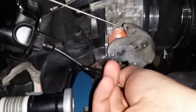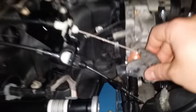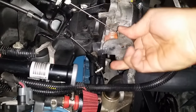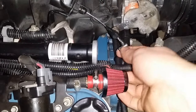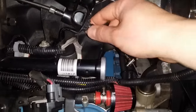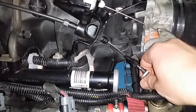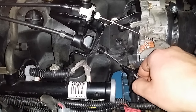This is going to be a problem child — I just know it. Made a little bracket for it and it gets full tension, full line pressure. The nice thing about this cable stop is you're limited in adjustability with the adjustment tab, but the cable stop basically gives infinite adjustability for line pressure and tuning your 200R or 700R4.